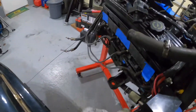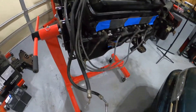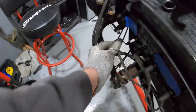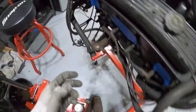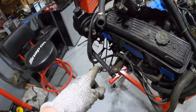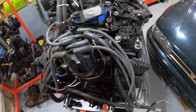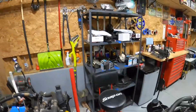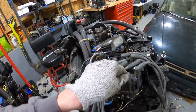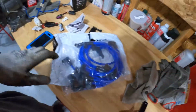First things first, we're going to pull our spark plug wires off and then rip out all of our spark plugs. We've got four on this side — for a small block Chevy, all evenly spaced, all faced at 90 degrees out. What I'll do so I don't lose the order the spark plug wires are in, and I don't have to do the headache of retiming everything, is immediately find the matching wire from the new set and route it in where the old one went. The new spark plug wires are blue — they match the boat.